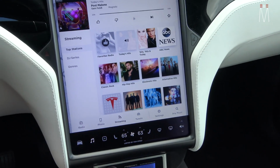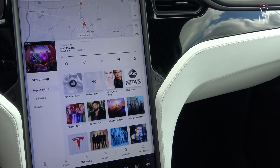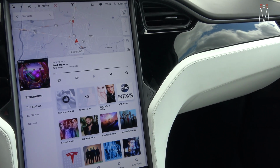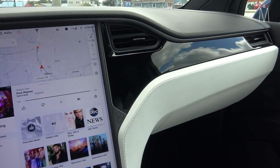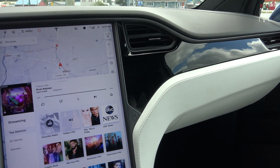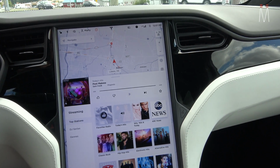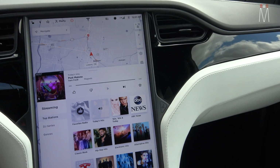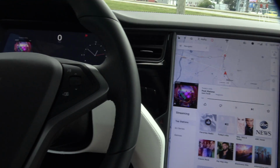In this one, we kept the back speakers factory, so those are unchanged. They're the factory speakers because they're completely irrelevant in this case. They're going to be high passed over 300 hertz and time delayed 8 to 9 milliseconds. So we're basically just creating a sense of space within the vehicle from our front stage in comparison to our rear stage. We really don't need to spend money there. I'd much rather see that money spent on something that could greatly improve the fronts, our amplifiers, our source signal, things like that.